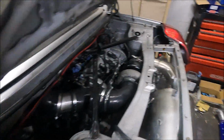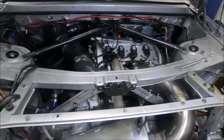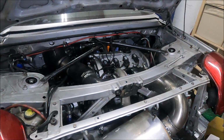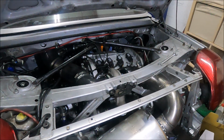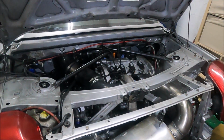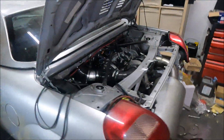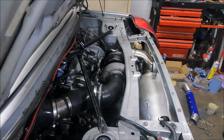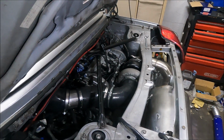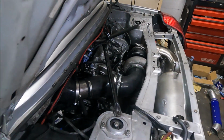What I was last doing was making a turbo oil return, because obviously it's a totally different turbo, so a totally different oil return. The spec is 19mm ID for the oil return, and most people run less and then cry that their turbo's smoking and it's their fault because they've used a tiny hole. You'd say, oh, it's not my fault because the eBay pipe I bought was tiny, but yeah, nearly all the aftermarket ones you buy are fucking tiny. They're like 15mm or less, or they use these fancy aerospace fittings, which again are tiny internally. They might be called -10, -12, whatever, but are they fuck that size inside? But that's your hard luck.